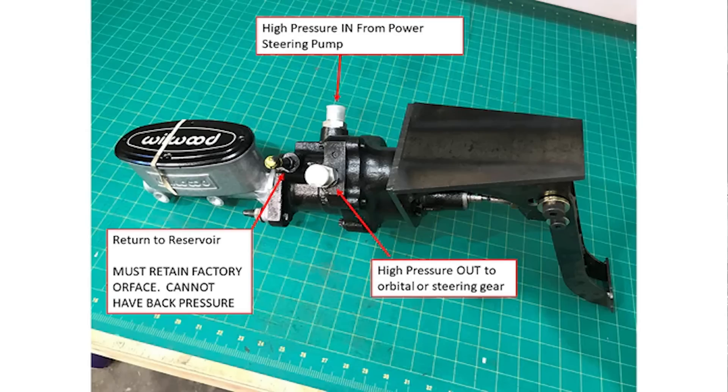They basically build two to three stops into the system if the engine's not running or if there's a hydroboost failure. Really, the main reason guys are going to hydroboost is simply more brake pressure — it's higher pressure, stops the vehicle faster, and it's less pedal effort, easier for you inside the buggy. There's a Busted Knuckle Off-Road bracket kit that lets you basically bolt it in and weld it into your tube buggy. I've used both systems — manual brakes, vacuum assisted, and hydroboost. Really, it's personal preference. Heavy truck stuff almost always goes hydroboost.